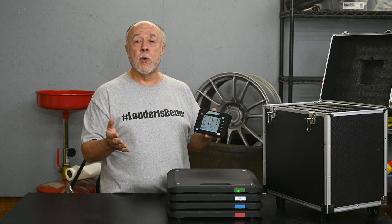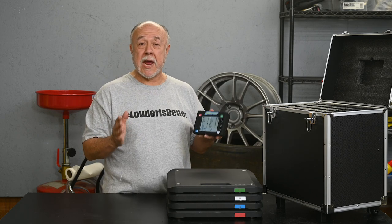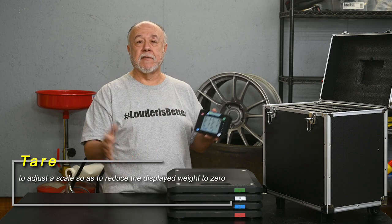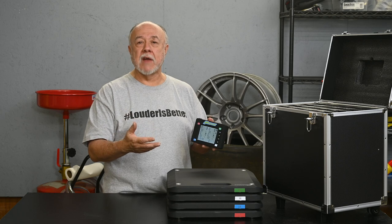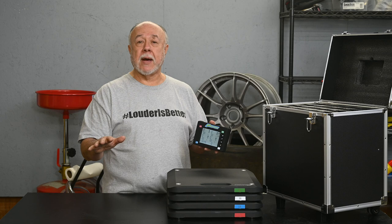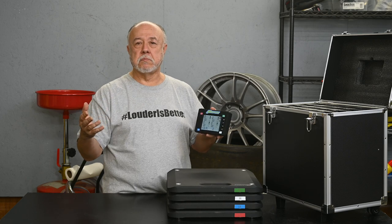By pressing the function button, you can switch between pounds and kilograms instantly. The unit also has a tare button — T-A-R-E — which zeros out the pads if there's already a weight on them. The main use I can think of is to see the exact effect of adding something to the car, like putting the driver in. You'd put the car on the pads, use the tare button to zero them out, then get in and see what effect it had on the weights without having to record numbers and do subtraction.